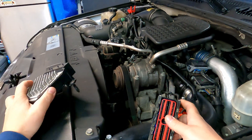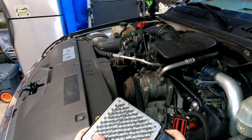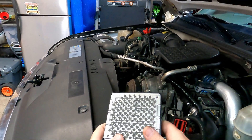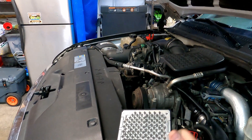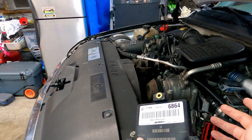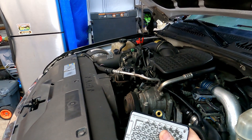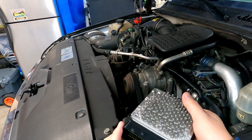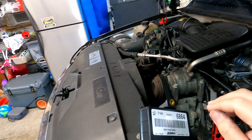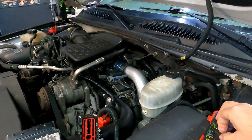Unfortunately the six-speed modules are a lot more expensive to fix — you have to replace the module. After research I did because my truck was in limp mode, I was looking at having it towed to a dealership and spending big money. The kicker is these have to be programmed — you can't just buy one and plug it in. But there are diesel service places online. I got this one from Ryan's Diesel Performance for $550. You give them your VIN number, they program it and send it to your house — plug and play.